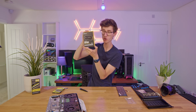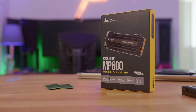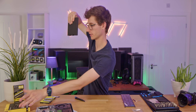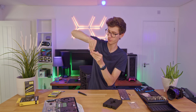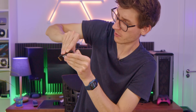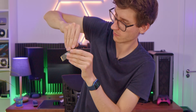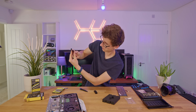And then it is of course time to install your new one. This is the MP600 from Corsair — very reasonably priced but very fast SSD, and this is two terabytes. It probably doesn't take a genius to work out that it has a very large heatsink on it, because you can use this in desktops and get slightly better thermal performance. But as this is going into a laptop, they actually make it quite easy to remove — it's just a couple of clips. The top bit of the heatsink comes off, which leaves you with the SSD itself.